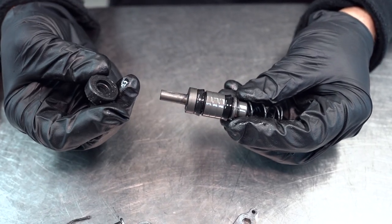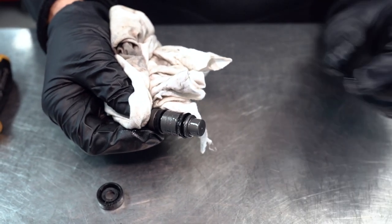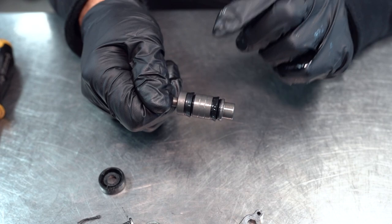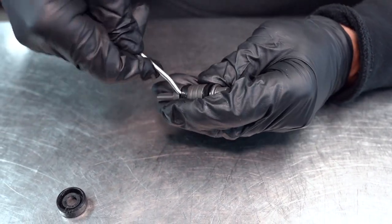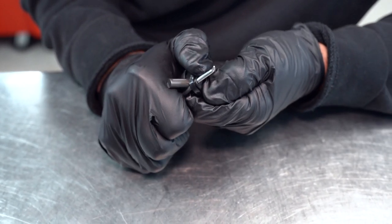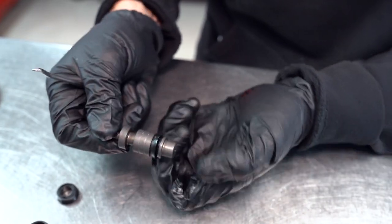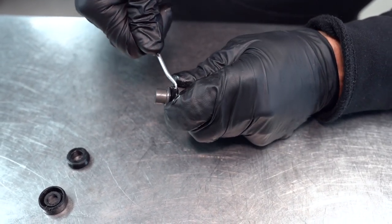With the brake piston removed, we can slide this seal straight off the end of the shaft. Give that a bit of a clean up. Take the spring off the other end and put that to one side — we don't need that at the moment. Now we're going to take these seals off using a blunt-off pick, and then we can reinstall the new seals. With the rounded-off pick so we don't scratch the piston, we're going to slide that down on the edge of our seal, get it up underneath, use a bit of leverage, grab your fingers on either side of the seal, and work that seal up and over the lip. It's the same for the other side — just rotate the piston so it's easy to work. Be careful you don't slip and give yourself a little puncture wound.